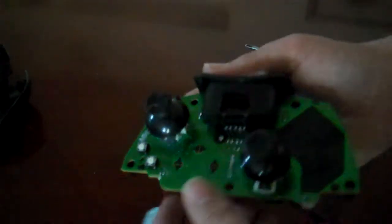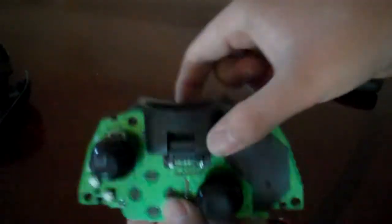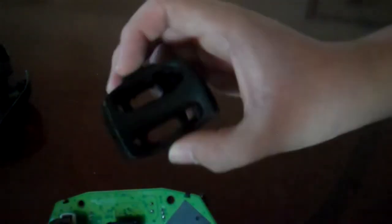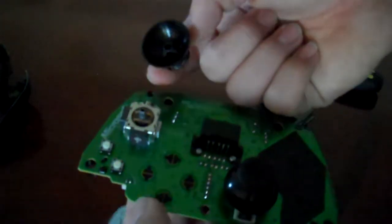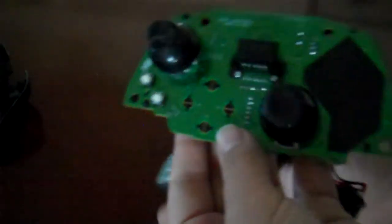There are a few different things you can do, but I wasn't taking out the rumble pack. To get this part off — I'll get in close here — you'll see these little things right here. These little things you need to kind of pop off. It's tricky at first, but you've got to be at the right angle and apply enough force because you don't want to break it. That will pull right off the memory card slot. If you want to replace the analog stick heads, they just slide right off.